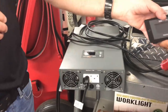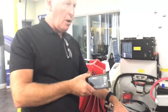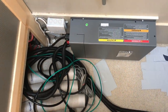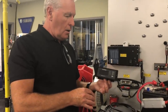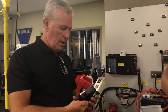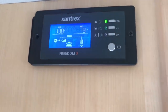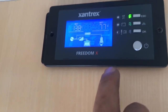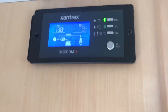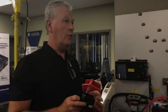We also have the ability for a remote. This unit is going to be mounted in a compartment in your vehicle. We're going to give you a remote which is connected by a telephone cable on the back of the inverter. You'll be able to mount it, see what's going on, and control it — turn it on and off. When you shut the system off and push the button, it goes off 100%. There is no draw on your battery at all.